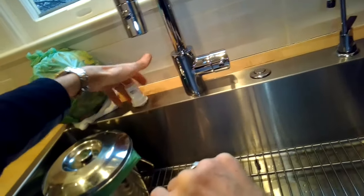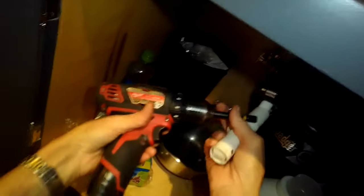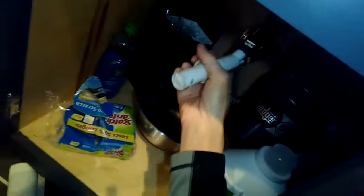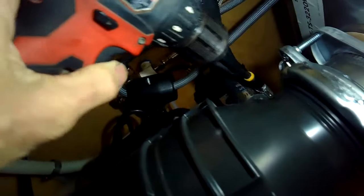We push the air gap down into the area underneath the sink, then use the screwdriver to disconnect another hose clamp holding a different hose going to the air gap. Once that's loose, we twist and pull to get that drain hose off. This is the hose that goes between the dishwasher and the air gap and the garbage disposal. Now we disconnect the hose clamp on the big rubber hose coming from the air gap, using a standard head screwdriver to leverage and pull that big black hose off the garbage disposal.